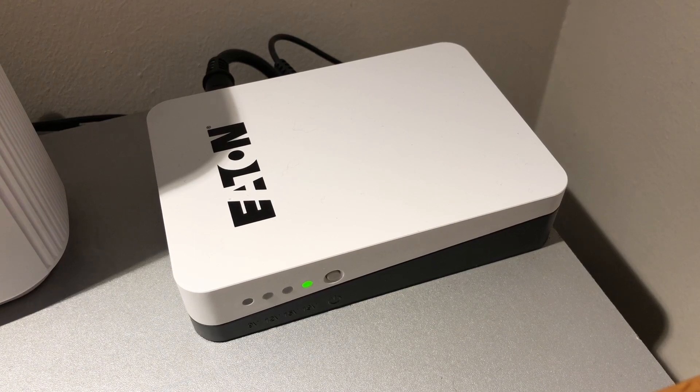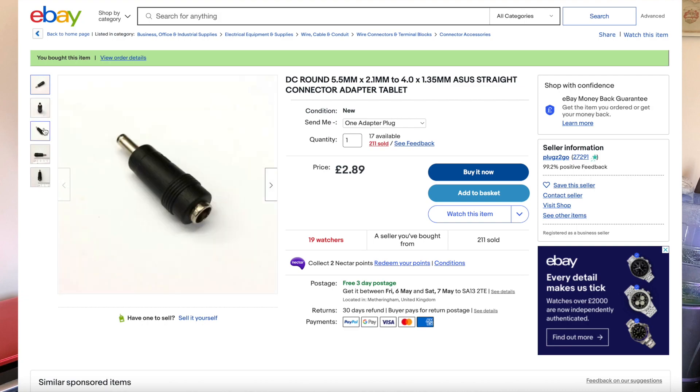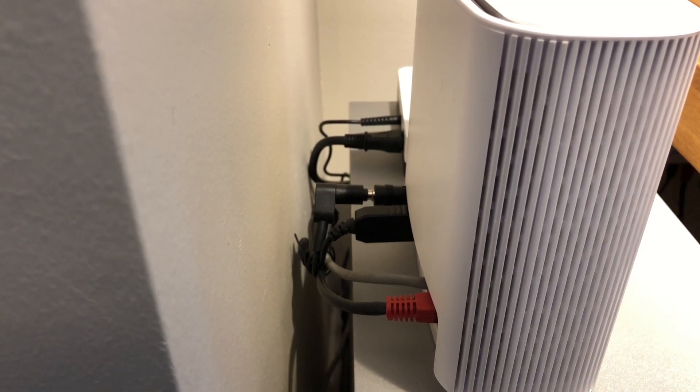A few days later — Amazon Prime was being a bit slow that week — my shiny new UPS had arrived. I plonked it down in its new home, plugged it into the mains, set the voltage to 19V, then tried to plug it into the Asus router using one of the four provided barrel adapters. None of those little wotsits fitted at all. After a bit of googling, it turns out that Asus use a proprietary barrel size, so I needed an adapter to convert a standard barrel size to the Asus one. I managed to find one on eBay. A few more days later, I plugged the adapter into the router and the UPS output into the adapter, and both the router and ONT are now powered directly from the UPS. I admit the long tail of adapters hanging off the back of the router isn't very pretty and is just asking to get damaged — I could probably tidy this up using right angle connectors or inline leads, but my router is tucked out of harm's way, so this would be an unnecessary expense for me.